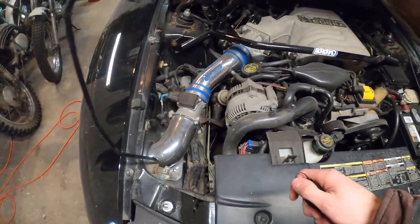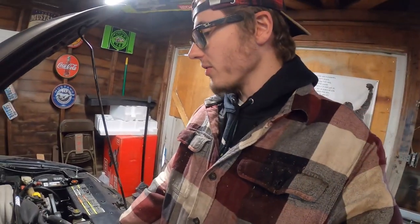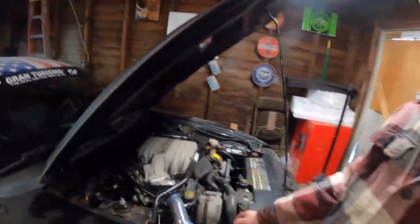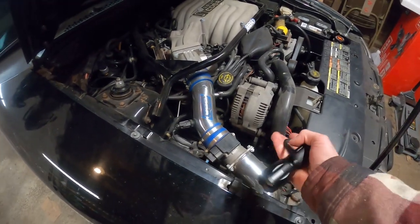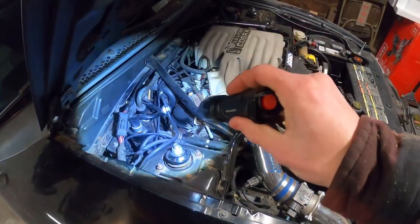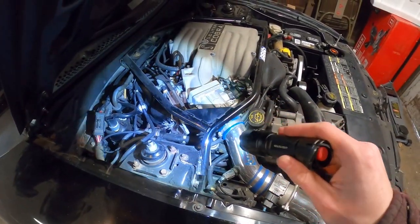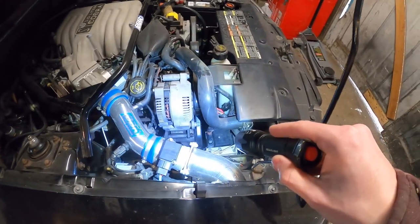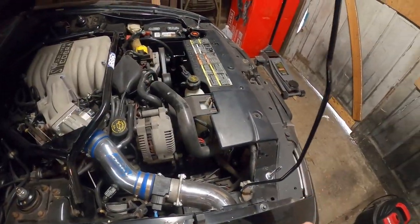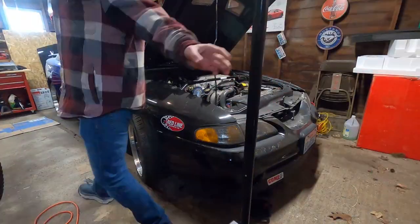The delete pulley. I'm gonna get rid of the, for legal reasons, I'm gonna call it the second AC pump. Obviously, you guys probably know what that is. It runs all the way back into the back of the heads and whatnot, and so I'm gonna get rid of that, plug the back of the heads, and then run a shorter belt, and it should be a lot lighter.